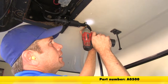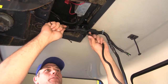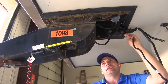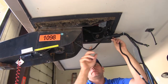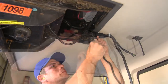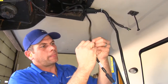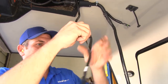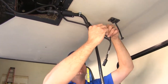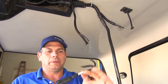We're going to use a loom clamp with another self-tapping screw and get that secured off to the underside of our trailer. For our breakaway switch we're going to bring this back, and if you do have a rotating pin box — in this case it's designed to rotate instead of having a slider — you want to make sure you have enough slack for that. Just zip tie it right off to the bottom of the bracket. Inside the wire loom here we have our two breakaway wires. Let's get those pulled out — give ourselves enough pigtail but also long enough so we can join it together with the three wires, so we'll trim it off about right there.